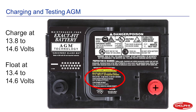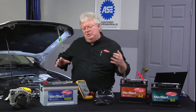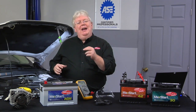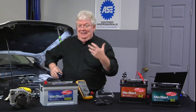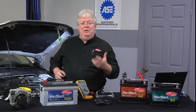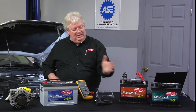These are some specs found on the top of AGM battery labels, with a little information about testing. If your battery charger does not ask whether it's conventional or AGM, err on the side of treating it as AGM and charge it with a trickle charger until you can get a proper charger that handles both AGM and conventional batteries.